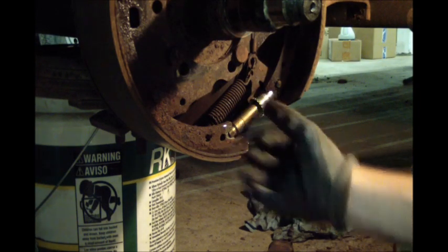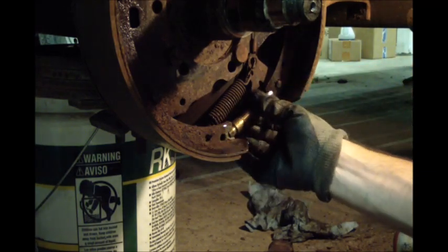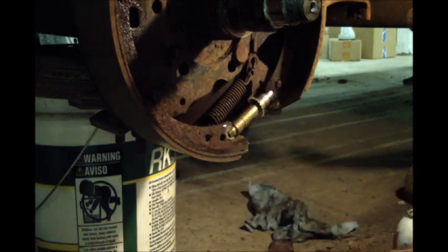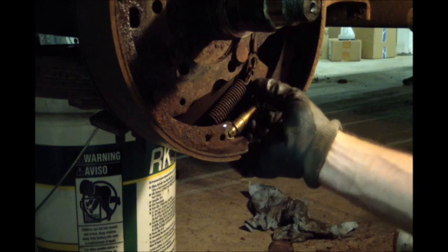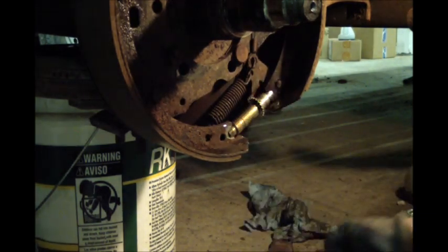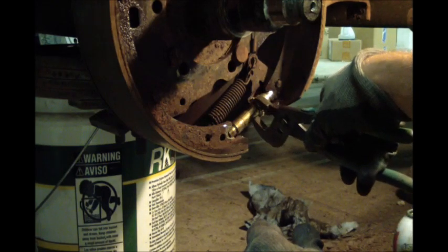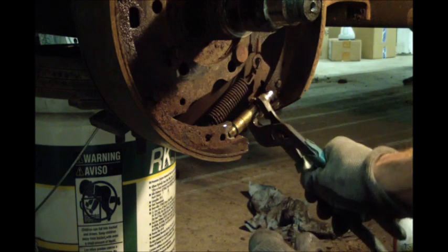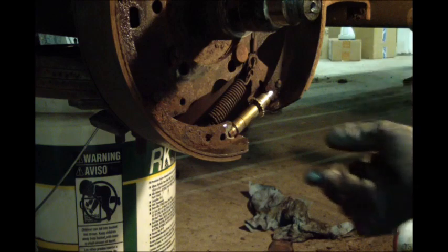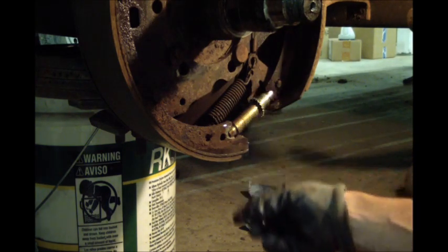Okay guys, I did a little touch-up grind on this and this right here. And this part fits good and nice. Even the adjuster is about in the right place. And you can get that thing to adjust the other way. So if I don't have a bar with me or anything to pry on, but wrench in the way. But it will click up and adjust. This is not actually made for these self-adjusting brakes, but I think it'll work.